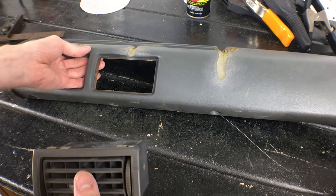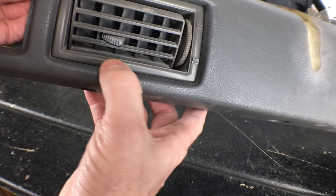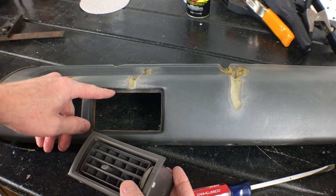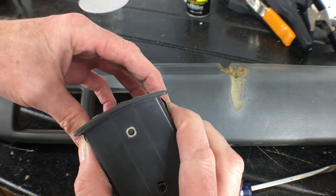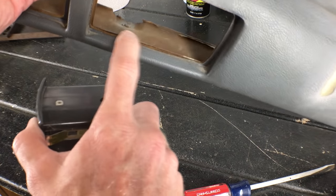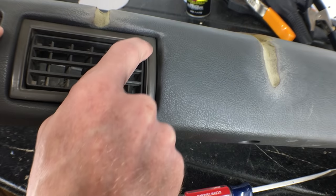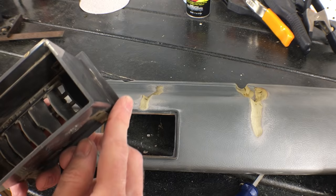There's another area where I need to remove some material. These vents are a perfect fit into the factory dash — there's no gap around the outer edge. The problem now is the vinyl is maybe close to 1/16th of an inch thick, so I have to remove additional material around the vent openings to allow for 1/16th of an inch on each side. Quick tip for removing these safely: once they're clicked and locked in, push down on these metal tabs from the back side and that releases the vent. There's a little raised area on the metal tab that clicks in and holds to the metal frame around the vent opening. I have a whole video on removing these vents and dash pad — I'll put a link in the description. The corners seem to be the tightest fit, so I'll remove material from there first.